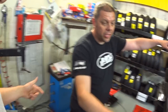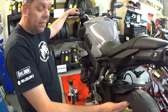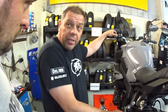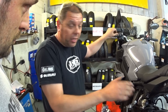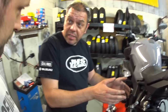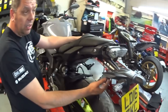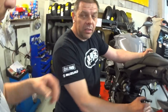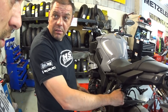If someone has changed their tires and noticed changed handling, what can they do? With this particular bike you've got an adjustable shock. You could play with the settings, or look at raising the ride height a little bit — just one complete turn, which is one millimeter — putting the back of the bike up and popping it on its nose a little bit more. That'll give it back its sharpness. And if you've got a sharp tire and want more stability, you can go the other way. Don't be afraid of adjusting this stuff — it won't bite you.